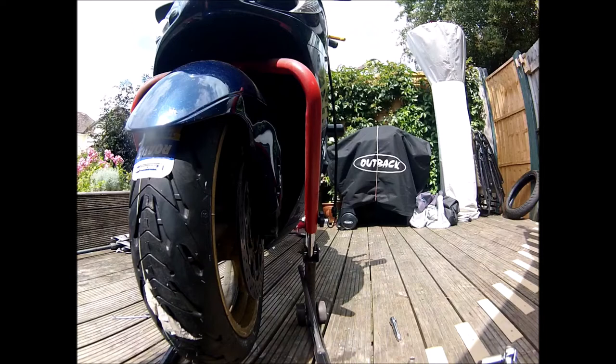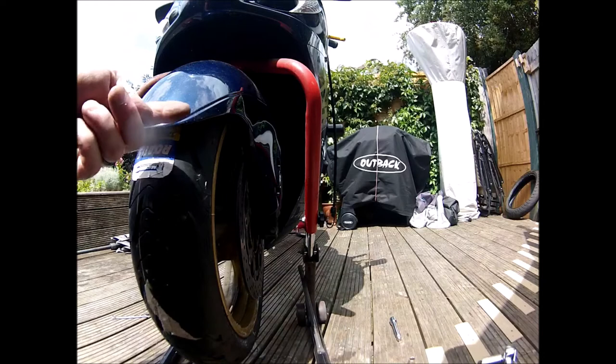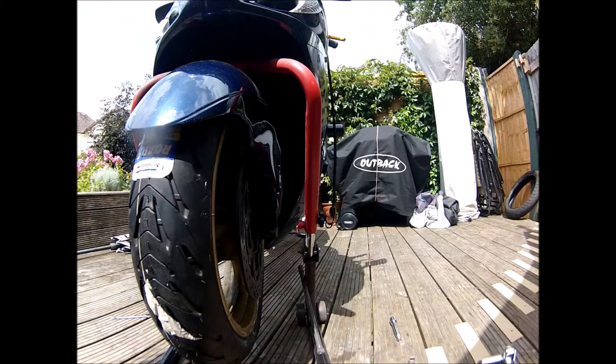And then move the motorcycle off its stand, apply the front brake and pump the front forks a few times to settle all components in position, and then tighten the right hand, because on up to K8 models you put the axle in from the other way, so I'm going with left hand side. What do they know?